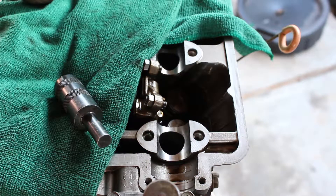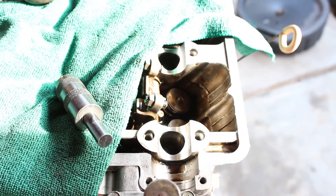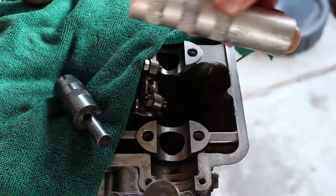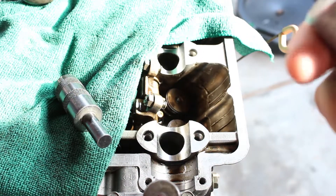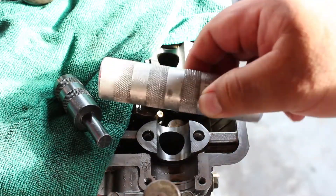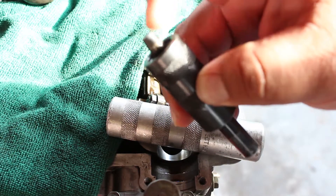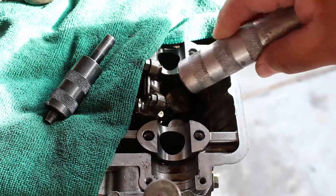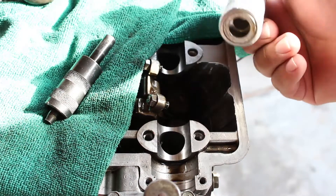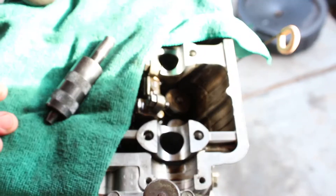That's why you get burning smoke when you're running — the valves get all stuck. We're on the last two and it's a pain, but I've been using this tool I picked off Amazon. It's a valve stem spring removal tool. It comes with this piece to put the spring retainers and clips back on, and this piece goes over the valve spring. You hit it with a hammer and it locks them up. There's a magnet inside that holds the clips.